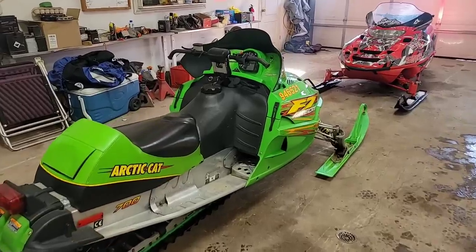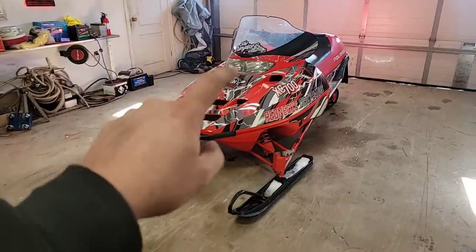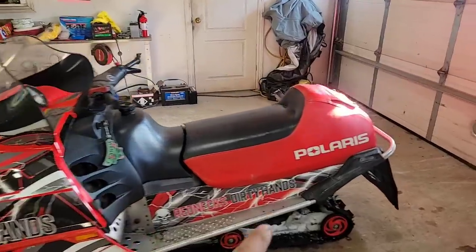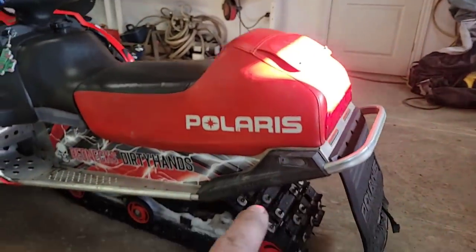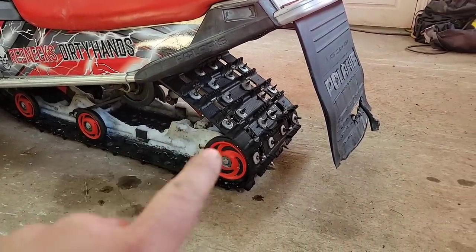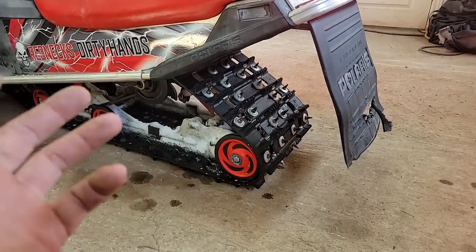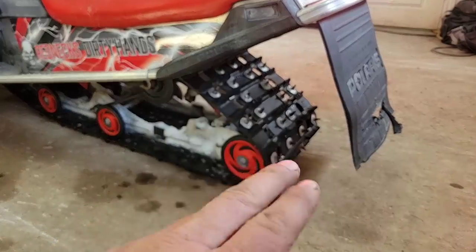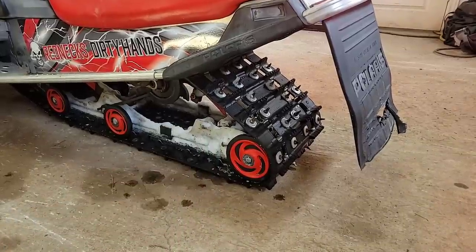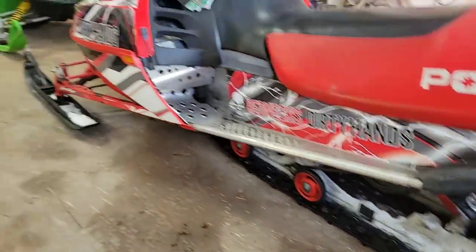So yeah, not sure if you caught the last video when I bought this one, but it's a real sweetie, and I'm hoping it can give this one a run for its money. Scooter's machine looks good, works really good, but I think one of the key reasons why it's working so darn good is it's got a nice aggressive track on her. It's got a decent panel on there, and it's rocking 144 studs. It's got a 121 there. What do they got? 48 windows. So your basic two patterns, 96 studs. And then he's got every second window, two extras. So yeah, that's 144. I think that's giving him the digging power to dangle and rock everybody else.